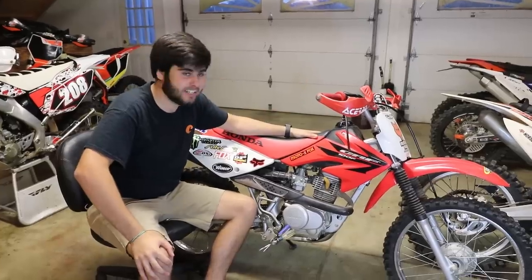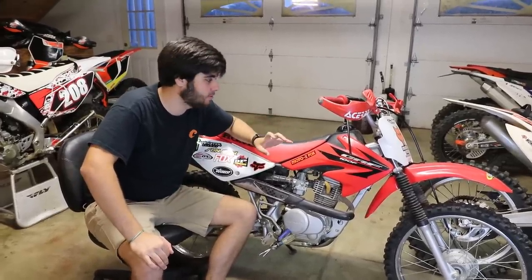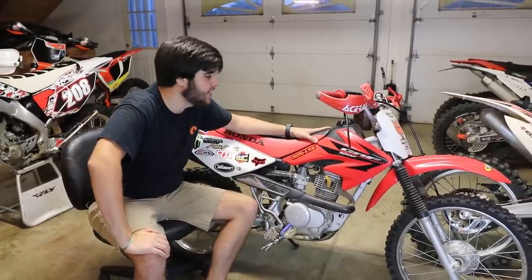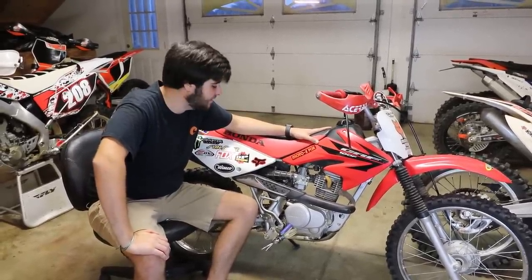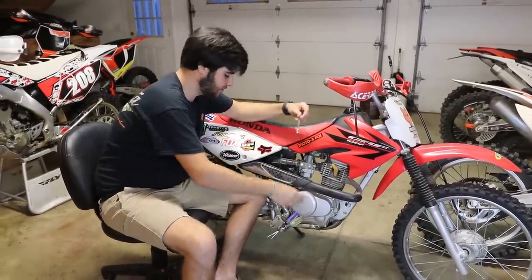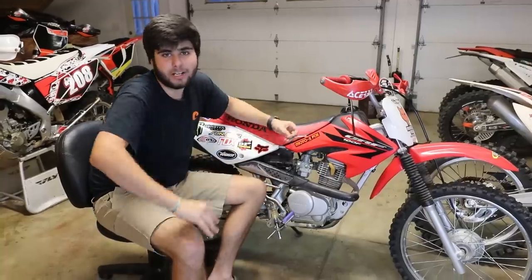So this bike is a perfect example of what's going on with all these bikes I've been buying off of Facebook Marketplace, Craigslist. He bought it cheap, it doesn't run, has been sitting for like 3 or 4 years, guaranteed carb issue. He's been trying to get it running, but he hasn't torn into the carb. I'm gonna tear into the carb, get the thing running, and it's gonna be pit bike race ready for this weekend. We got a CRF 100 here. Now, like I said, he bought this bike for a low price because it's been sitting for 4 or 5 years. Obviously it's going to be a carburetor issue. He brought it to me, his fellow mechanic, and we're going to tear this carb off. And all we need is a 10 millimeter wrench, Phillips head screwdriver, and the regular carb cleaner and stuff.